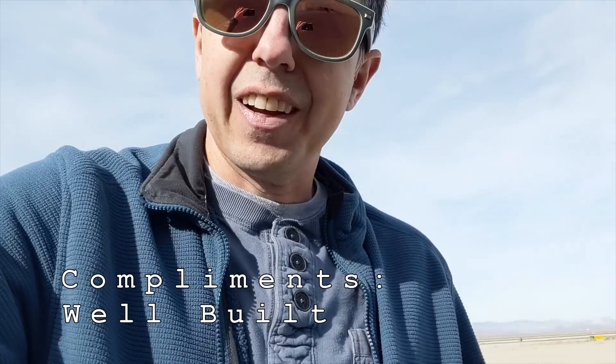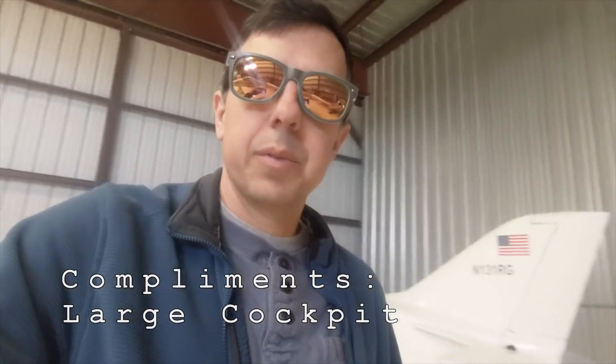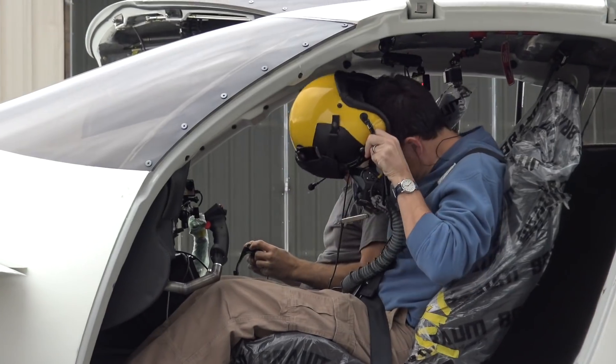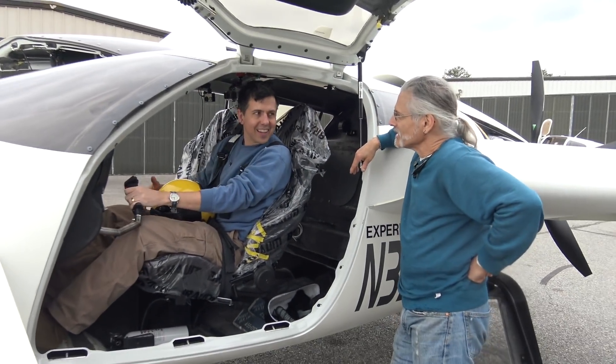The fit and finish of the airplane is very good. You can tell the guys who built it had composite construction experience. The tooling they pulled it off must have been a major pain to build because the parts look fantastic. The other great thing about the Raptor is that massive interior. Peter designed it with passengers and owners in mind wanting people to be comfortable, but from a test standpoint it means I can set the seat where I need to — plus three inches from my parachute — and get the door shut with my helmet on, no problem. The seat raises as you slide it forward, so if you have an over-the-nose visibility problem, you deal with it that way. The rudder pedals are also adjustable pretty significantly, so it ends up being a great platform to get all your test equipment into the cockpit.